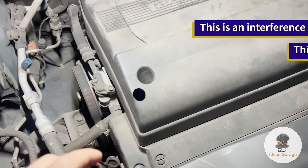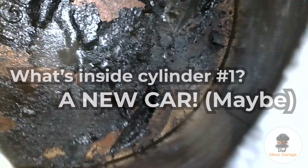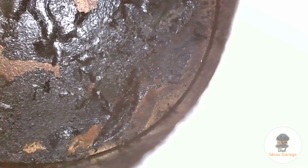I'm going to pull a spark plug out just to get an idea if the valve train is completely garbooned or not. But yeah, that's kind of where we're going to start with this project. First things first, four bolts right here at the top, 10 millimeter. Very easy. Just a flathead there, and this pops up. Then you take a hex and pop one of those coil packs off. I think the spark plug doesn't look that bad.